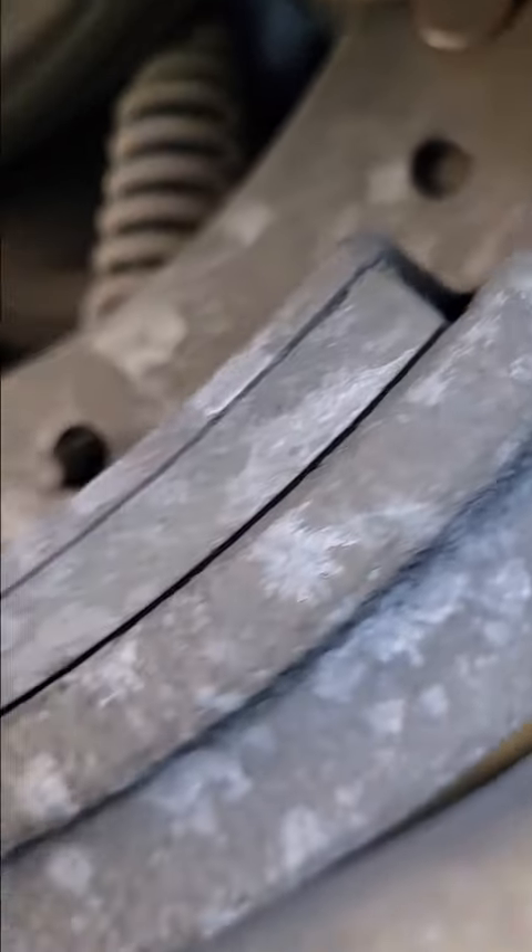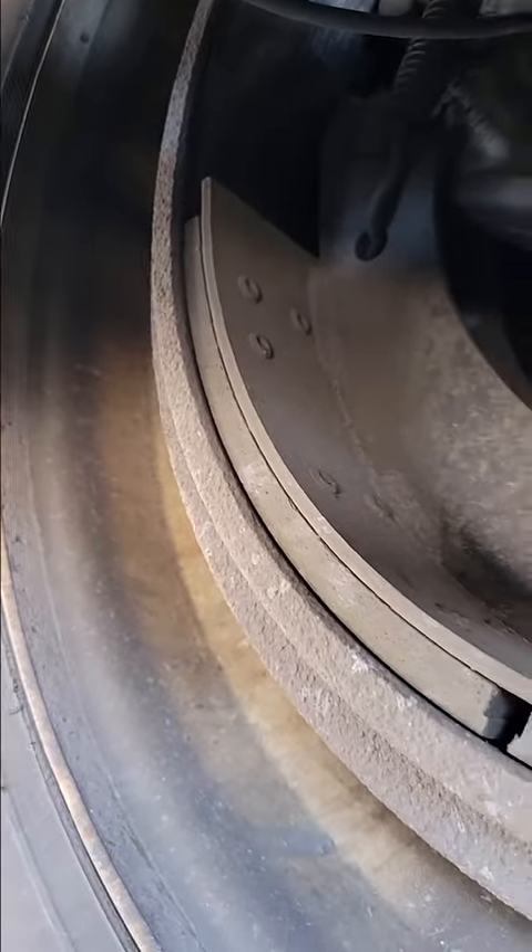So this one is legal. You see this second layer that begins right here. However, as soon as that section runs out, you've got an illegal trailer. But this is low enough that you're going to want to make some noise and just point out to someone that these brakes are going to be run out before too long.